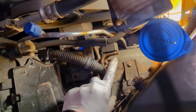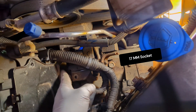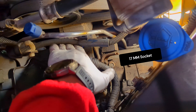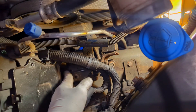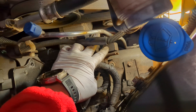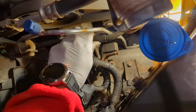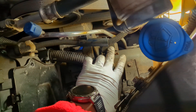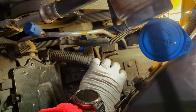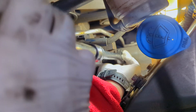There's another 17mm bolt securing the mount to the engine bracket, and there's also a damper here. Before you remove it, just remember the orientation — it's very important. You may want to take a picture of it — the orientation of the damper. 17mm, and without an extension, it just fits.